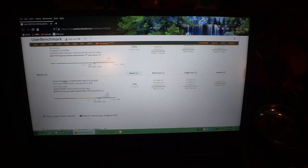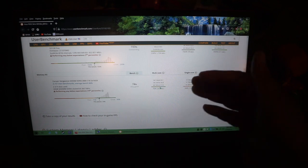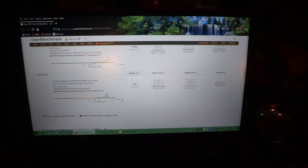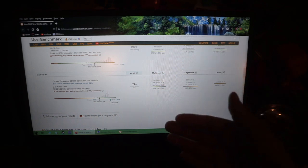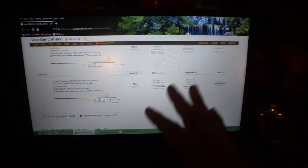The memory kit we just installed — it tells you it's Corsair Vengeance SODIMM DDR4, and the speed is 2666 megahertz. There are two of them, two 16 gigabyte sticks, adding up to a total of 32 gigabytes of RAM when clocked together. It reads at 29 and writes at 27. It's within the 70% range, and like I said, there's not much difference between 2000 and 2666 megahertz when you run it in total.